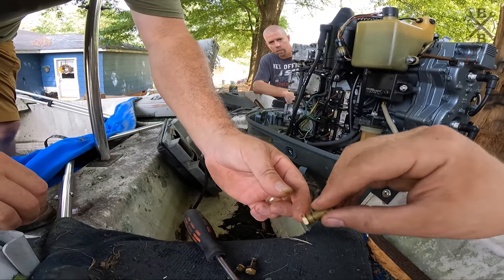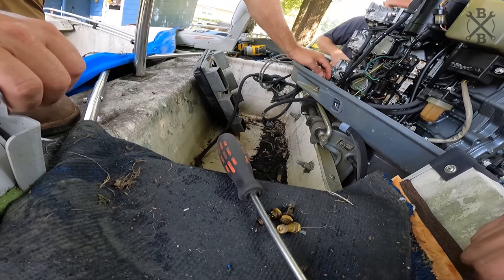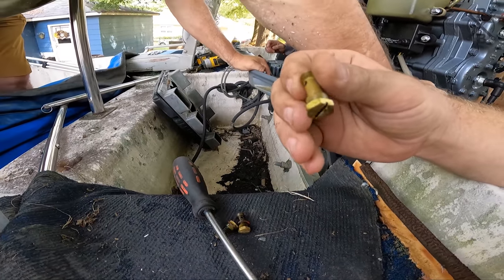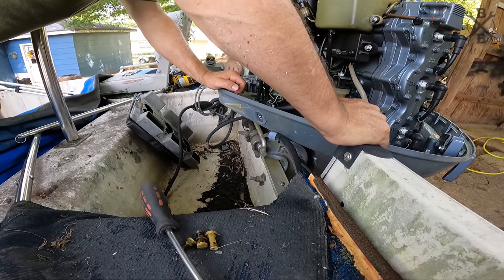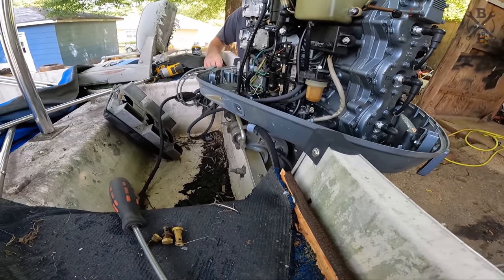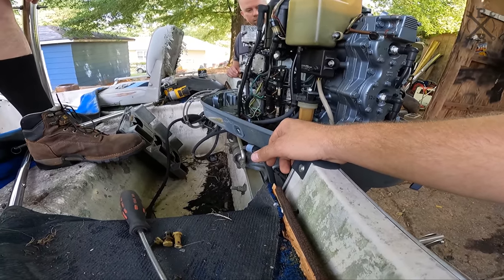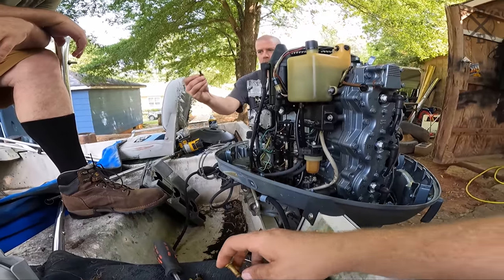There you go. That's the prettiest one of all. That one's missing the bottom on both sides. That one's missing the gasket. Yep. I don't think I felt it fall off. Look how clean it is. It looks like it's probably been washing straight through. Yep, both the bottoms were that way. The bottom on this side was clean, but it does have the gasket, though. I bet that carburetor wasn't running. The floats are stuck on it or something. If it's clean, it probably didn't have fuel in it. Yep, both sides. I think you are right.